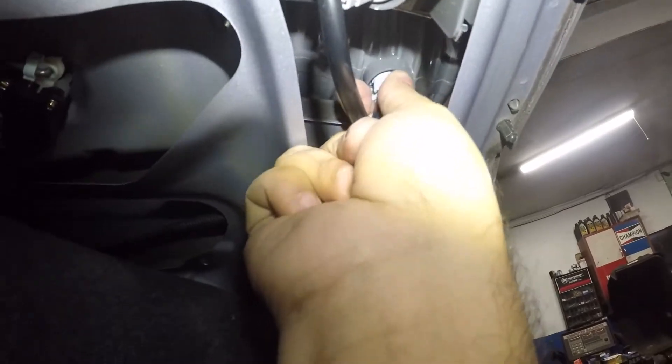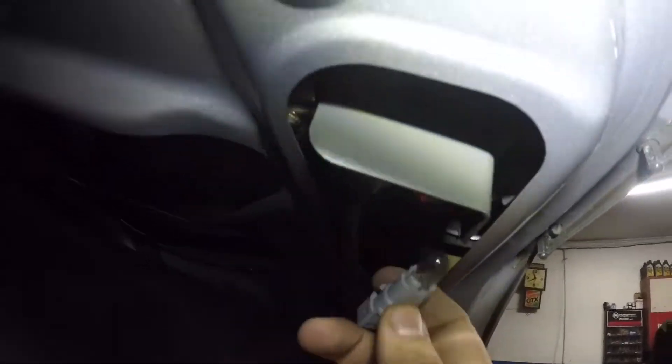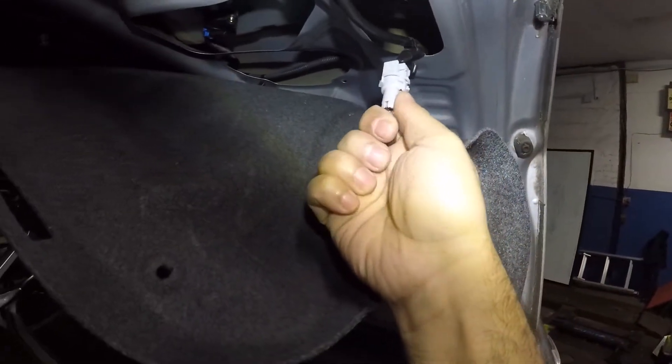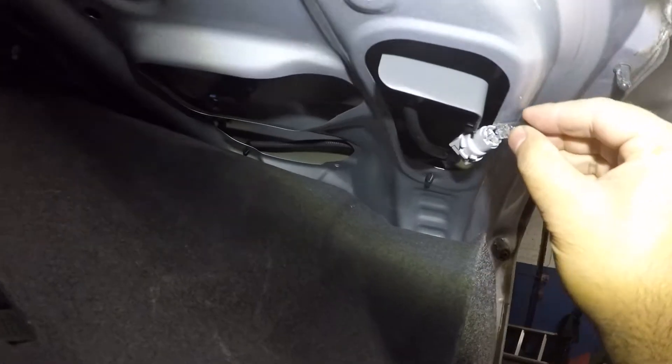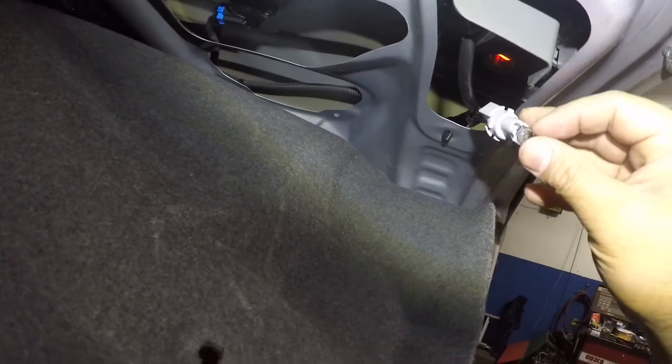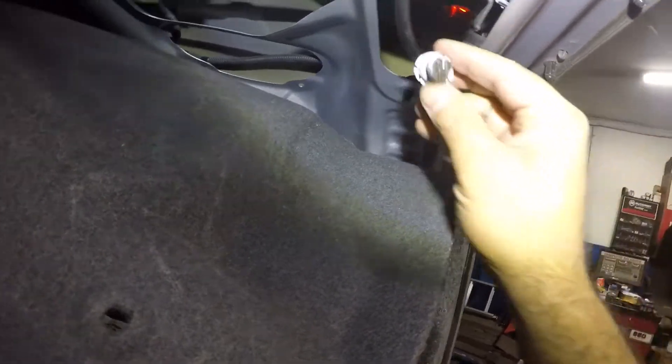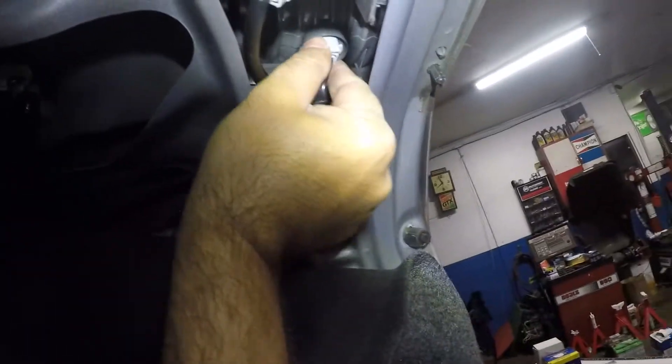Then we have the regular light that illuminates when you turn on your headlights. If that bulb is out, it's the same procedure. All you do is grab this and turn it counterclockwise — it's going to be a small little bulb. The size is 194 — yeah, 194. It's a miniature bulb. Doesn't matter which way you put it, you stick it back in. Make sure you get it straight, just like so. After that, line up everything where it's supposed to be.